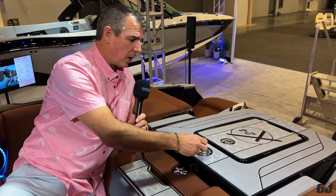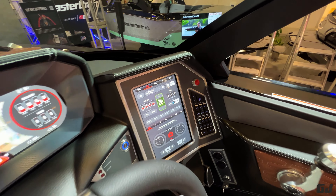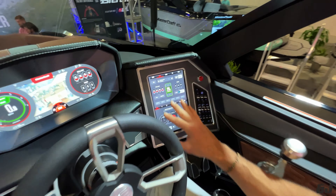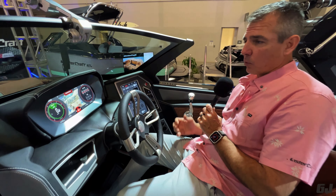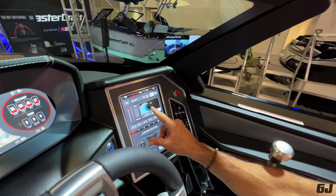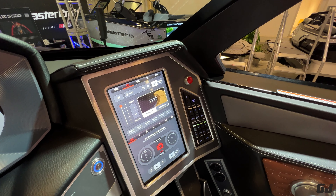Another important part of wakeboat function is right here for the driver. It's really important to be comfortable in this position, have easy function, and what happens here has a big effect on what happens behind the boat. We have two screens — this is our control screen. From the highest level we have modes: drive, surf, wake, ski, and chill — chill as if we're just floating in the cove after our surf session, and it's going to balance out all our music. When we go to our surf screen, this is where it becomes really easy to set up a wave for our rider. This one-to-seven scale is the size and amplitude of the wave. One is really mellow — that's what we'd use to teach ladies or kids to surf — while seven would be an advanced wave for a pro, giving more push and more resistance in the face of the wave, making it easier to let go of the rope. I can slide this up to seven, watch my wave change, and change it over to surf left if somebody wants to surf on the left side — everything is automated from that point on. It's going to fill the ballast and deploy our tabs to create that wave shape and make it really easy from a driver's perspective to set up the wave for the rider.